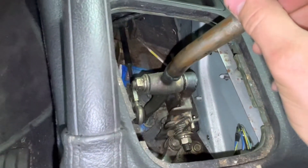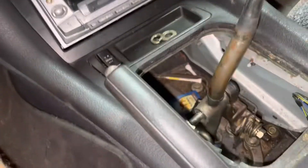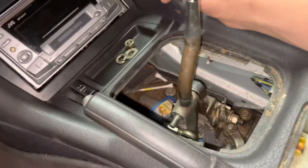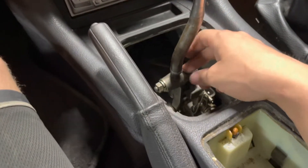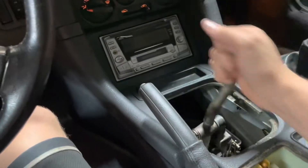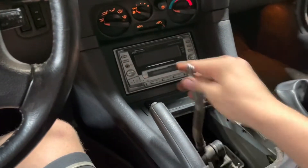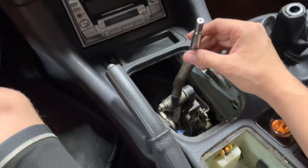We need to fix that space in between and stop the wobble. I'm going to take this off and put another spacer in, or we'll see. I found a random washer and I'm going to add it in front of the rest of the washers to see if that fixes it. After adding the washer in the back and the front, it's now super solid. Feels so much better — not going to miss first gear anymore. That's how you fix a sloppy shifter on a 3000GT yourself.